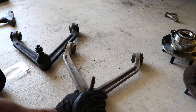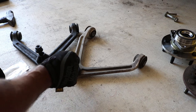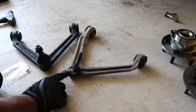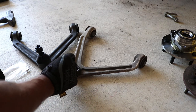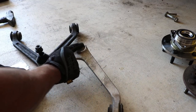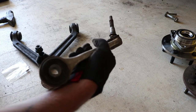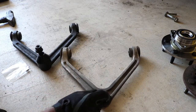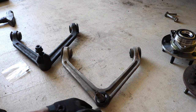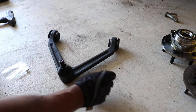Here we have the old upper control arm — as you can see it is pretty whooped. Like I showed you, the bushing is actually gone, there is no bushing there anymore. Something important to note: the top of these upper control arms from the factory don't have a grease fitting, so you can't go back and re-grease them. That's sort of what kills them and then you end up going back to the dealership. With the new upper control arm, you get a new nut and washer with nylon built in.